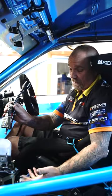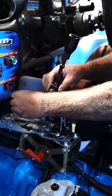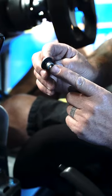You've got your shifter here — the old one's already out. Sit the shifter down, make sure the bottom bush, the little one, locates in the bottom there. Get your bolt, push that through from the front, line it up, beautiful. Then we have the spacer with the bush on it, that's going to go on there first.